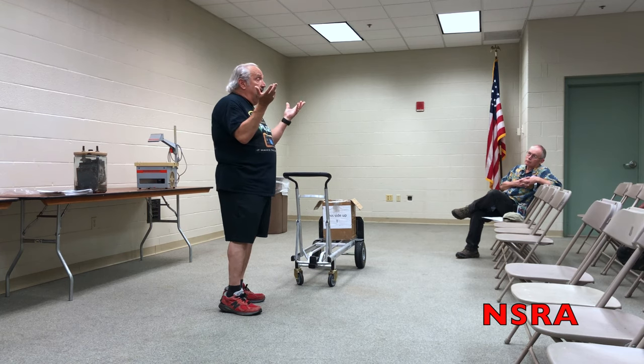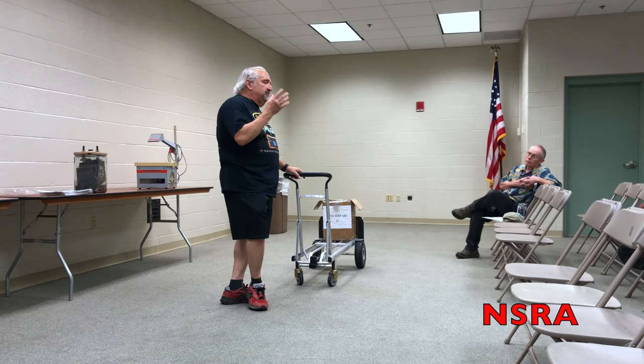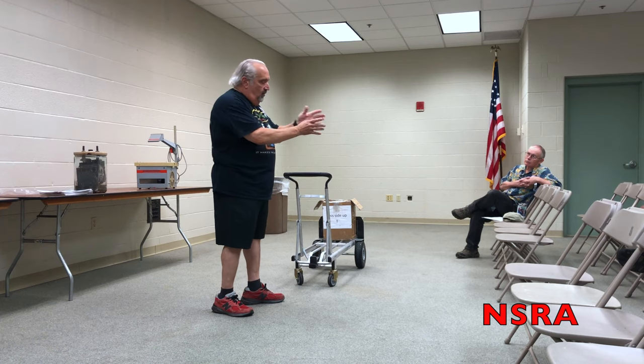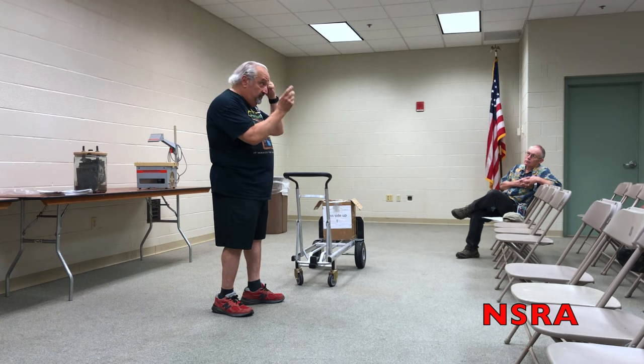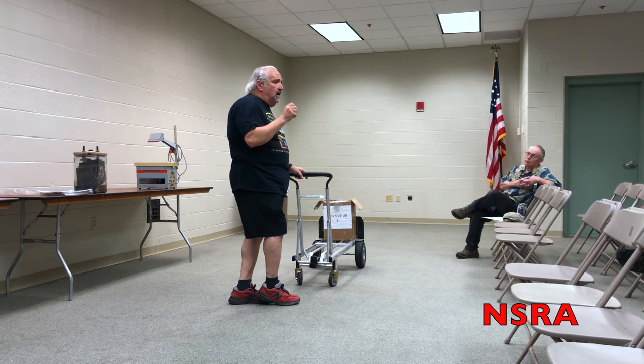So they came out with AGM, which stands for absorbed glass mat. Instead of just water and sulfuric acid, where you've got a wet battery, they created a gel. And now they created an absorbed glass mat between the plates, which holds those things together and doesn't let them separate. They still separate, but it takes about a year. But if you're gonna store a battery and you're not gonna use it, and you're not gonna plug it into a charger, an AGM battery is a better solution.